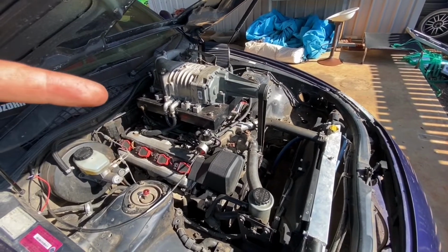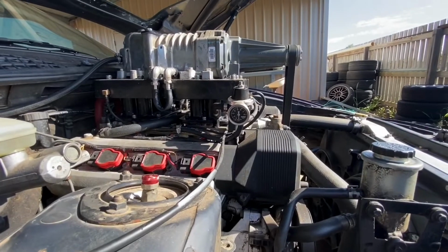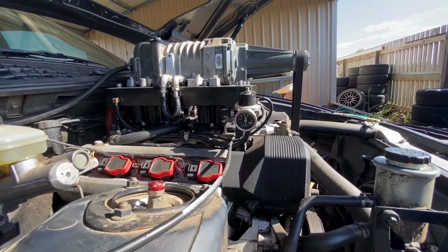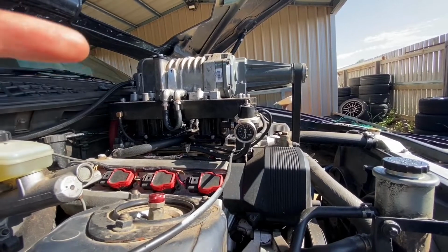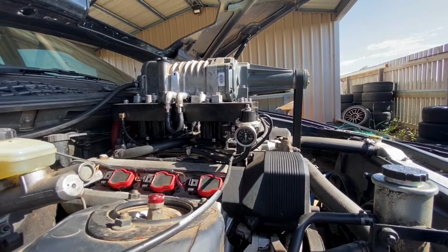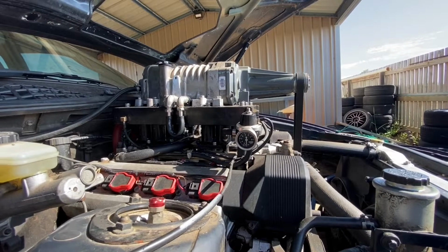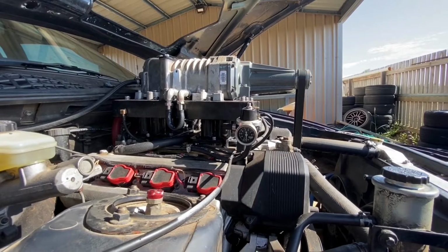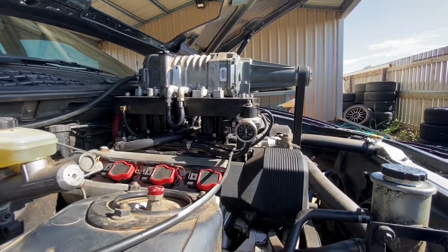Yeah, custom intake manifold there. So it's all made out of 10mm plate and risers that come up off of the stock lower intake manifold into the plenum there, and then the charger mounts to it. So those little lines there. Recently fabricated up an intercooler setup for the bottom side of that plate. So it's sort of just imitating the Mace mini Blizzard kits that came out on the V6 Commodores. So if you want to know more about that, you can go on their website and check them out, or check out my Instagram for the photos of that.